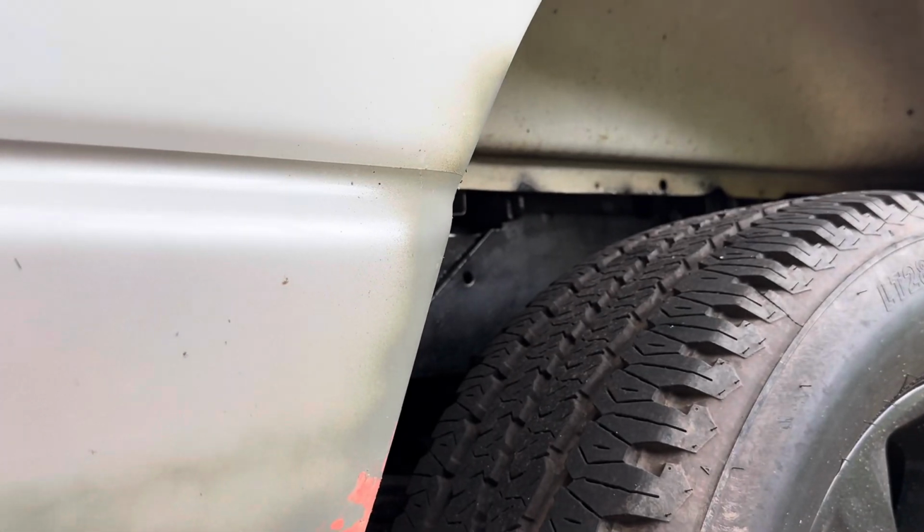So yeah, pretty much the same process I did with the undercoating, but on the body, and a little less, I guess, heavy strength. Don't need to rub it too hard with the 120. Just take off the surface, and like I said, go from there with 400 or 600.